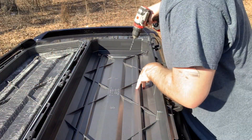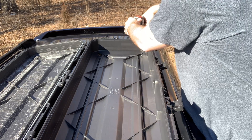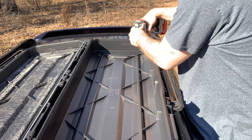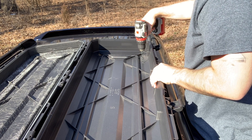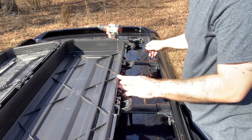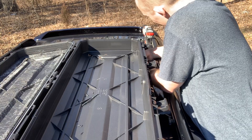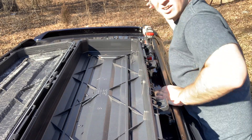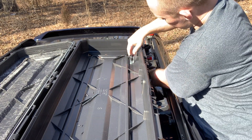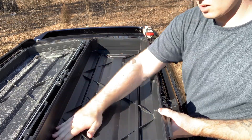Take your drill with your drill bit after you've marked it. As soon as you pop through, don't keep going because you will start drilling into the roof of your truck — as soon as it goes through, stop. Then go up from underneath, go around the bar, and line it up with your holes. Take the bracket they gave you and put it over top. Then go ahead and screw the end caps on — first one, second one, third one, and fourth one.